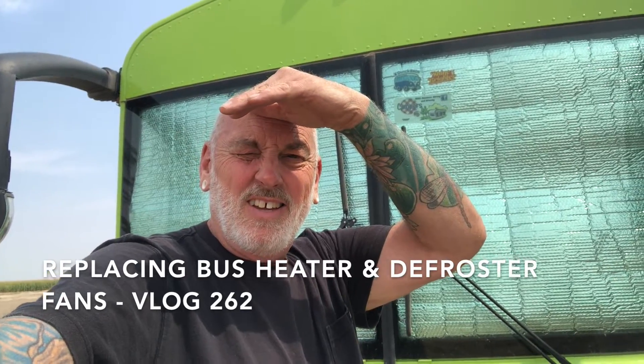What's up YouTube — just another little project. The blower fans for the defroster and the main heater: on the last trip, when we were going over the big mountain and the bus started getting hot, I chose to turn on the heaters. That's one way you can help your bus cool off — it's almost an instant response. So I turned on the main cabin heater and then I thought I'd turn the defroster on too.